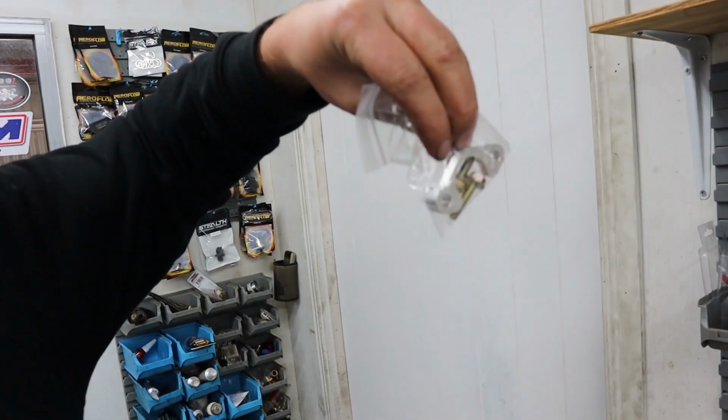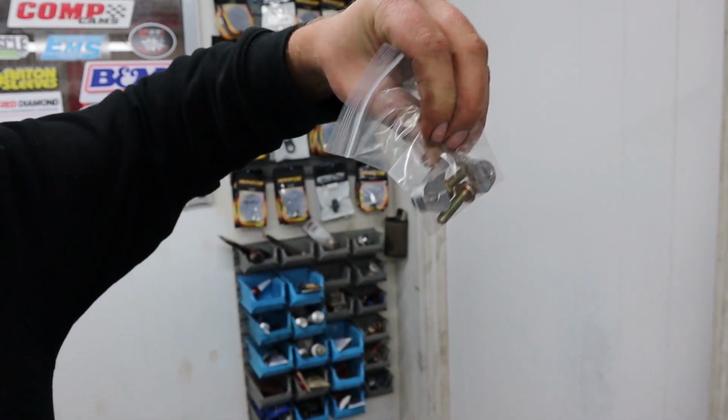It's a terrible thing. We also have these oil pickup girdles. Now, I'll show you when this oil pump starts going on, but there are two bolts on the oil pump for the pickup. Only one is utilized from factory. So these are just a really cheap bit of insurance, particularly when going dual row, for that exact reason that I was talking about, because it physically moves the pickup slightly, and sometimes it's not done right. This is just a good little bit of insurance to ensure that your pickup tube is going to stay nice and tight into your oil pump with your fresh O-ring, and it's always going to have a good seal, and it's never going to start sucking air and fail and become a problem, because when that happens, you can pretty much say goodbye to your bottom end fairly quickly, and your top end as well for that matter.